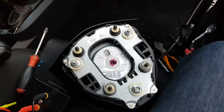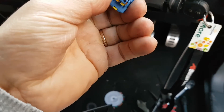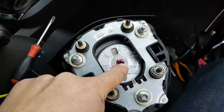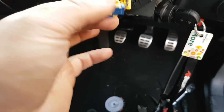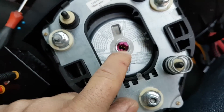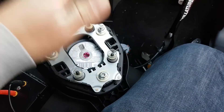Anyone familiar with this knows already - the shunt has been removed. What was happening: when this plug goes in, it's supposed to push that shunt away from the pins to stop the short and make contact just to the pins. But as the plug was going down it was not pushing the plates back, so it was always shorting the airbag. Even with the plug in, it was always shorting over here. That was the problem. I removed the shunt because it was nearly impossible to do anything with it, and as you've seen it resolved my issue.